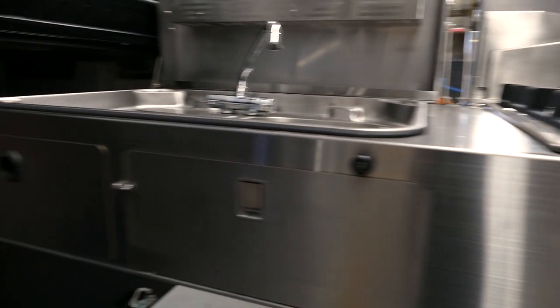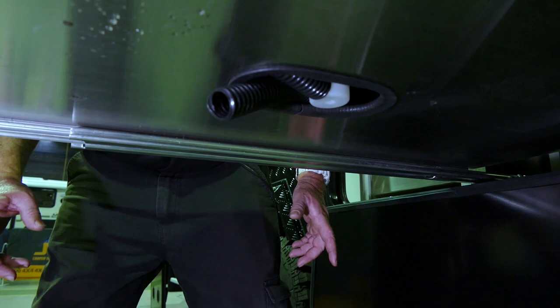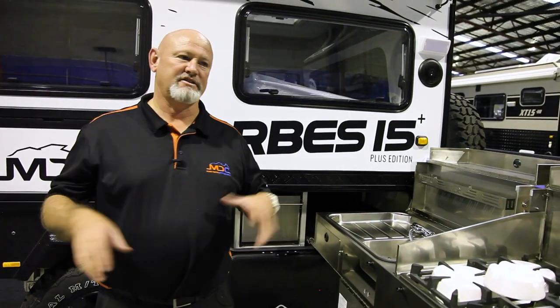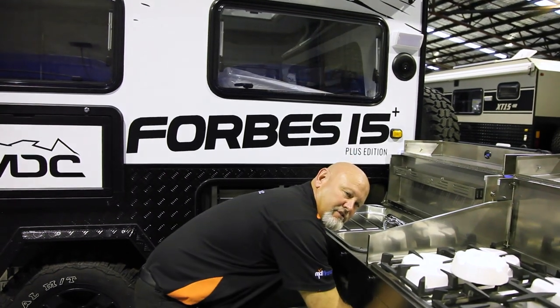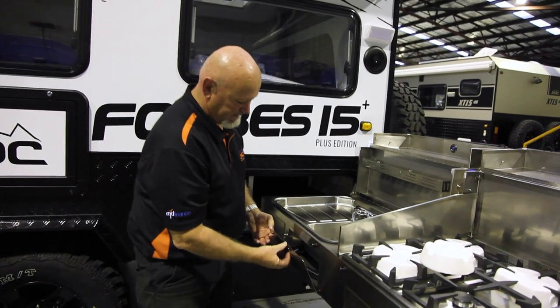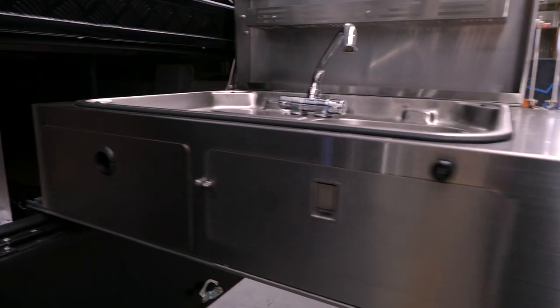In this second drawer, you have a black hose — your wastage hose from your sink — just protruding out of the bottom. Pull it out and put it into a bucket. Dispose of it properly — please don't just throw it around willy-nilly. If you've got a place to put it, do so. When you want to put it away, hose back up almost into the drawer, not quite, then latch it back up with your thumb so it holds into place.